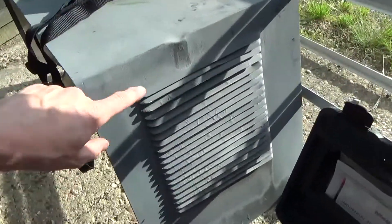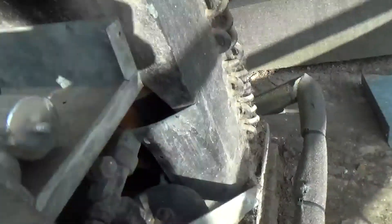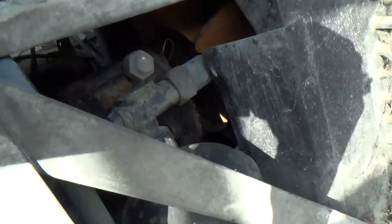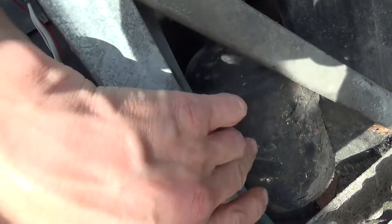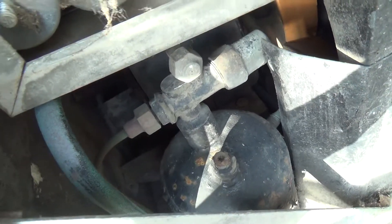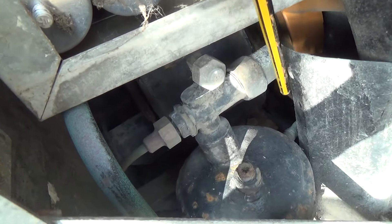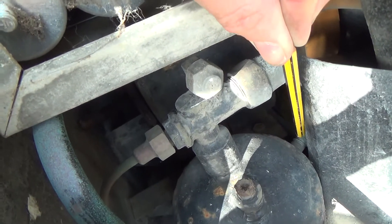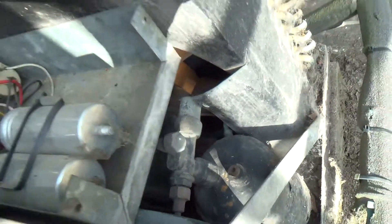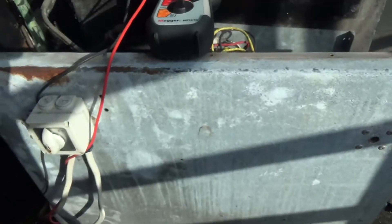It's got levers on either side — it pulls the air in, I think. This has been bodged up by somebody. It shouldn't have a receiver on it; that's off of something else. That's an old Frigidaire receiver. They've soldered a bit of quarter-inch copper into a flare connection just down there. It's just made out of bits and pieces.